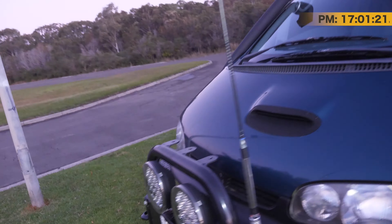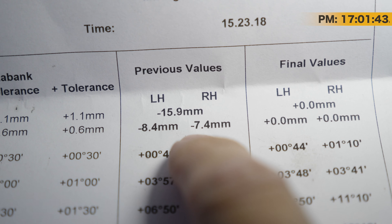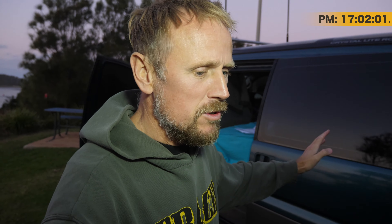Let me show you the actual mechanical report because this will tell you more than what I can tell you about what they found. It's quite bad actually apparently. The toe-in and toe-out on this — that's what we're looking at — 8.4mm on the left hand side and 7.4 on the right hand side. That's actually a pretty bad amount. The toe-in is where the wheels toe in or toe out. You can only do it on the front wheels, so it's been fixed and there's no more squealing, which is a good sign. If it squeals, you need a wheel alignment, and now there's no squeal.